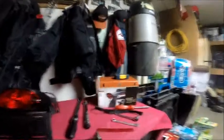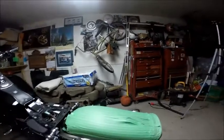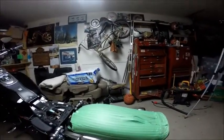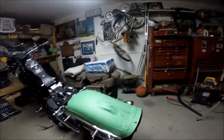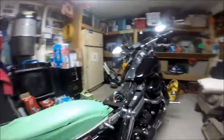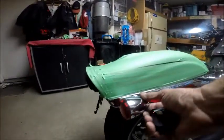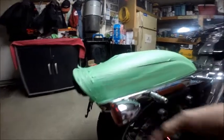So I've got all my tools set up and we're ready. What I've done is I've put masking tape on my rear fender — masking tape is cheaper than paint, obviously. And then what we'll do is disconnect the wiring harness for the tail light and turn signals, and use hex head 5/16s that hold the fender on with the brackets. We also have to just take the turn signals off.